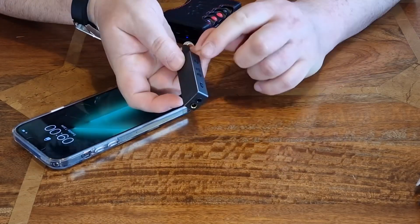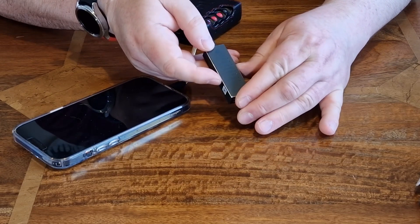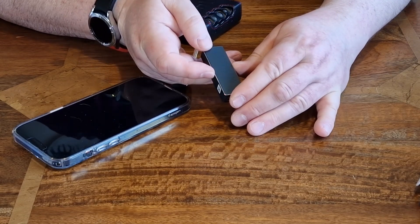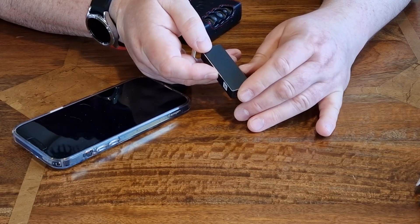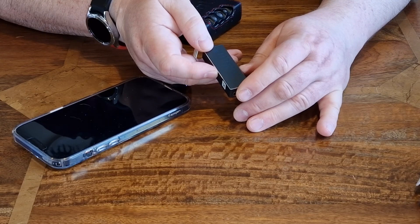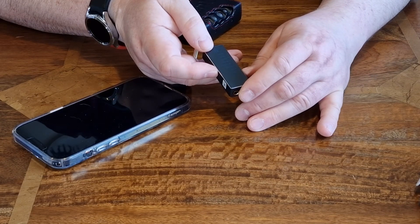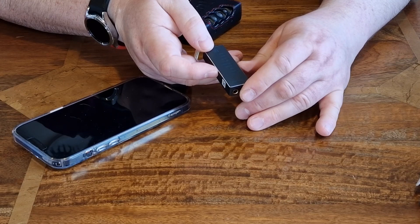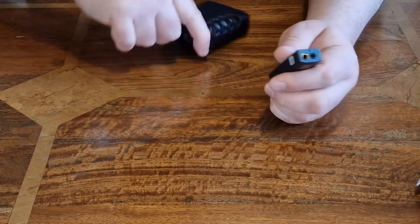You also have the filter button. If you press the settings button for a couple of seconds it starts flashing, then you can use volume up or down to cycle through the different filters. You've got Bit Perfect, Standard which is red with modest pre and post ringing, Min which is yellow for minimum phase slow roll-off with minimum pre and post ringing, and GTO — Gibbs Transient Optimized — upsampled to 352/384 kHz with minimum filtering and no pre-ringing. I personally just use Bit Perfect.